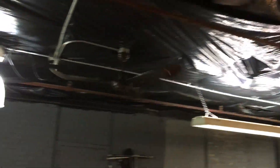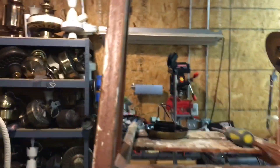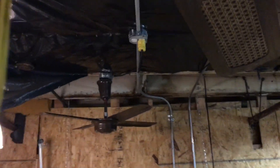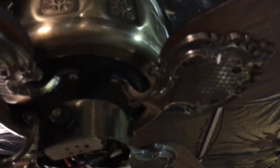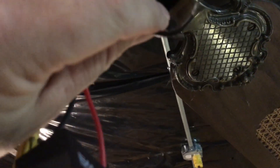I still have the blender fan and the new Tone Pro line, but this Moss Emperor I've taken apart because I'm not sure what's going on — it does not run very fast. I replaced the capacitor with a 10μF because it actually uses a 9.5μF original, which tests good, but sometimes it's not always good even if it tests good — it tested at about 9.4. I also took it off the variable speed to run it straight; these two wire leads are for the variable speed knob.